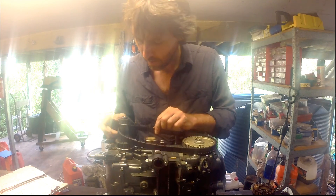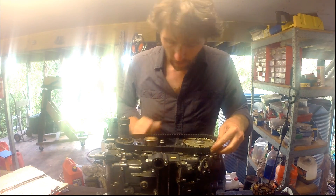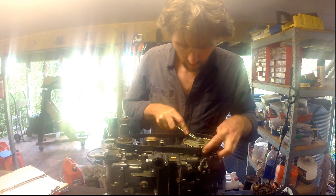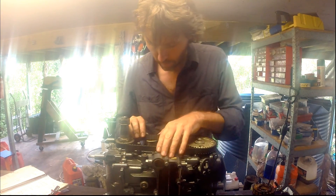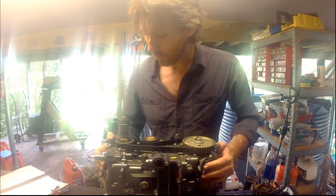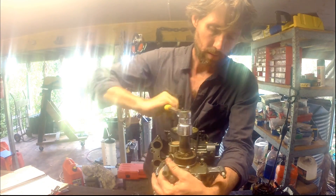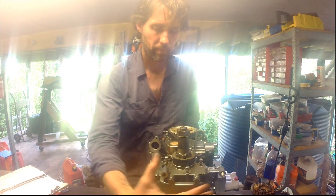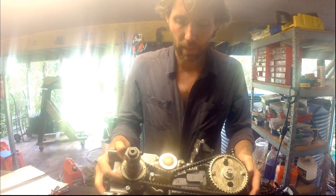Because this one's got the lip, I'll get it on here first. Now I can just pull this tensioner out. I'm going to give it a couple of rotations again and see whether it's aligned properly. Yeah, that seems better. Top dead centre on the crankshaft, top dead centre on the camshaft — that's what we want. That's really important.